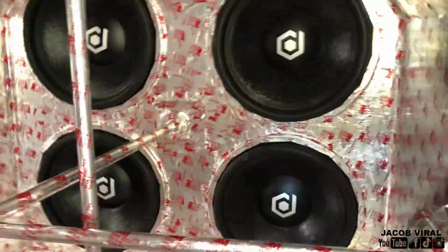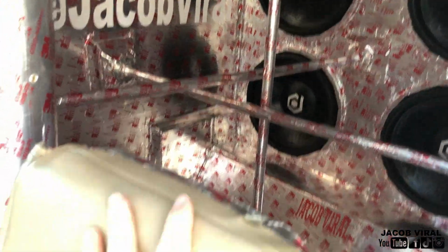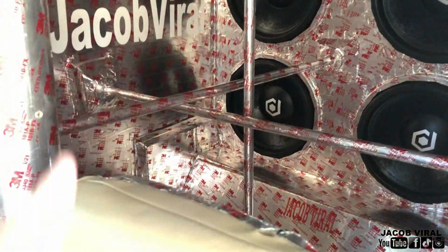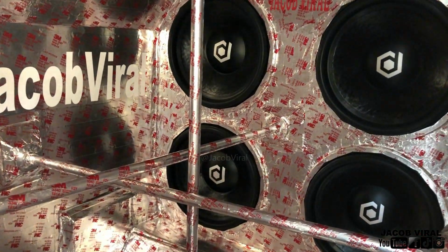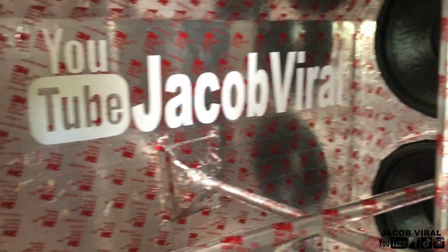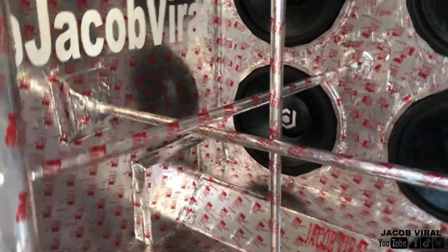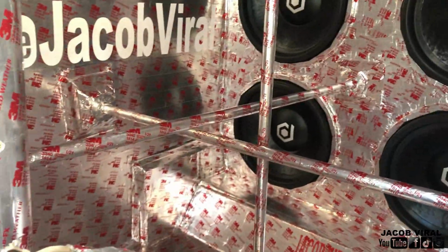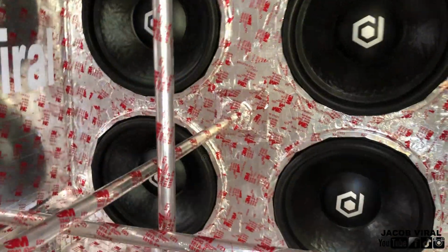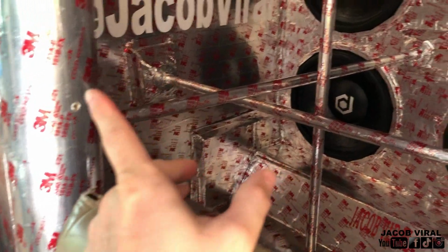I definitely am a little unhappy that it's peaking a little higher, but that's because my port, I opened up about an inch from before, and I did that because I compensated for the seat. I wanted to have a little bit extra room for the seat when I was doing the test, so stay tuned for that. I did a little bit more trials to test on that, and I found out I was a little louder when I had this port opened up just a little bit with the seat in here. But when I put the seat forward, my peak rises, but I have that compensated. So when I'm driving, it's actually louder with the seat forward, if that makes sense. But with the seat here, it's not as loud, but it's a little bit more musical with the opened up port area. So that's a downfall of anybody that's considering going driver port for this.